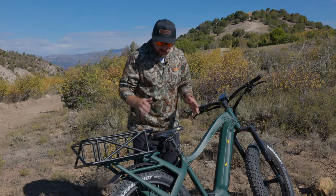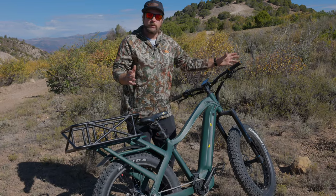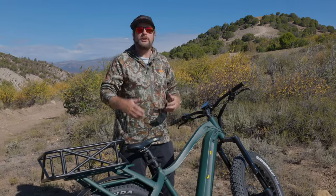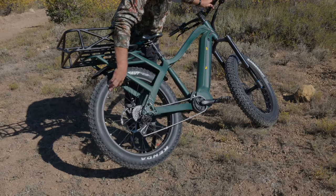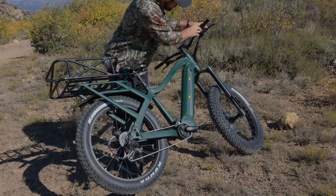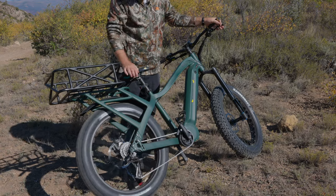So what do we do in this situation? We're down in the hardest gear and we're about to go up a steep hill. The first thing we're going to do is make sure the bike is powered off so that when we go to crank the pedals, we don't injure ourselves or someone else around us. So the bike is powered off and it's on the kickstand. You're going to lean the bike up so that the rear wheel can rotate freely, and then you're simply going to use the thumb shifter and rotate the pedals to shift all the way up.